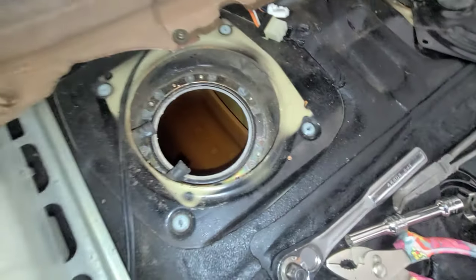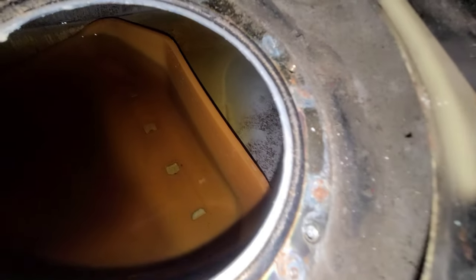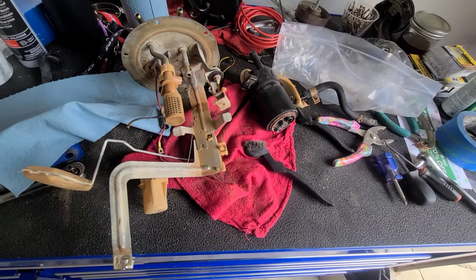You can see how the fuel crosses over — that's your fuel tank. We still have some fuel down in there, and this car has been sitting for a couple years, so we need to evacuate the fuel out of both sides. We'll use the evacuator for that. It is extremely flammable, so make sure you're not using any heat or ignition source. With the hoses, if they're really tough to get off you can use WD-40, but do not use a heat source near fuel.